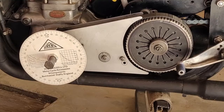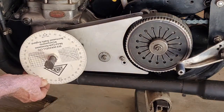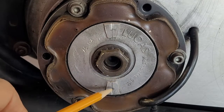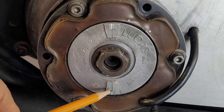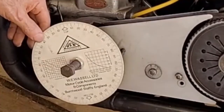What I've done is shown you bottom dead center, because the piston's at the bottom. So you want to adjust the degree wheel so it's on bottom dead center. Some rotors have two lines 180 degrees opposite each other. So if this is bottom dead center, this is top dead center. If you don't have two lines, you'll have to remount the degree wheel, spin the engine 180 degrees, so you can make your marks at top dead center.